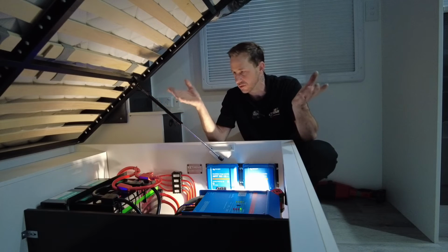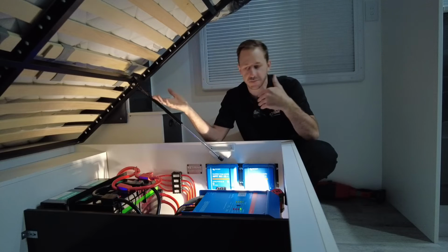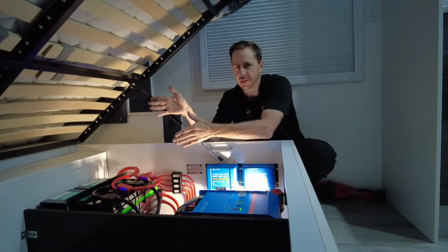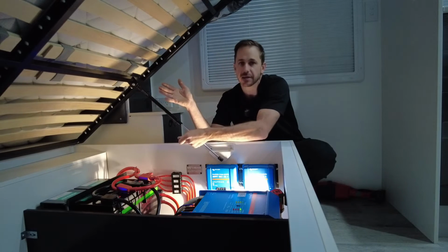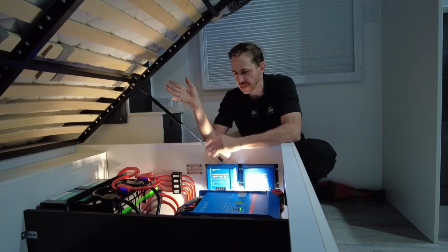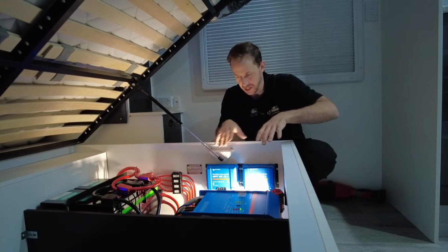And you know, why not? You've got free energy flicking around, the sun's out, you're driving, you have an alternator spinning, why shut one off? You utilize both to fill up the lithium. And lithium loves being charged. You generally feed it an amp and it'll take it. The low internal resistance of a lithium battery is far superior, and it works. So those are the charge rates.